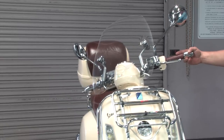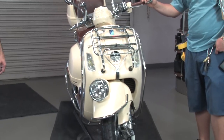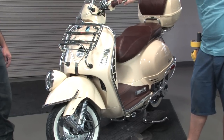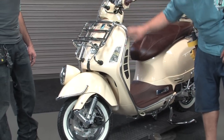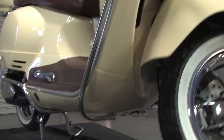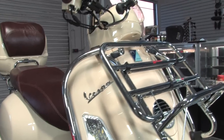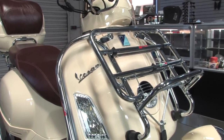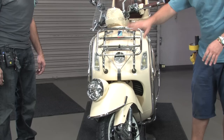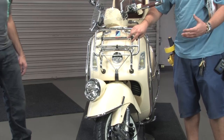The next thing that really stands out on the front of this bike is the protective leg shield bar. FACO is really the first company to develop such a thing — there was a German company that made one several years ago, but the fitment was atrocious so we stopped carrying them. The FACO bar runs from the very top all the way down and mounts to the undercarriage of the frame. The upper mounting point is shared via a special tab welded on the front FACO rack. These two parts — GT11F and GT13F01 — are sold individually, so you need the rack and the bars as two separate items. This is actually the first time we've installed one.